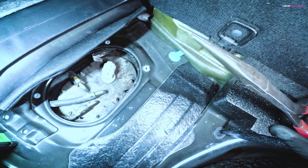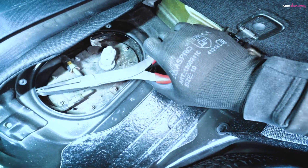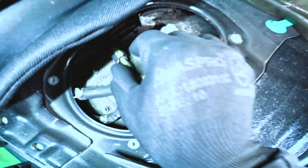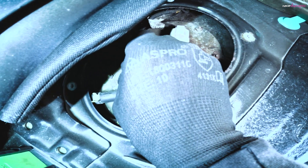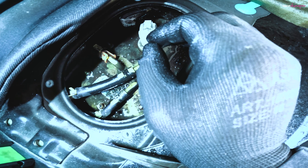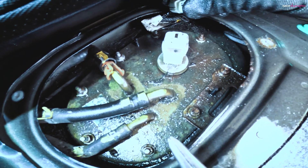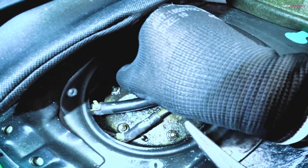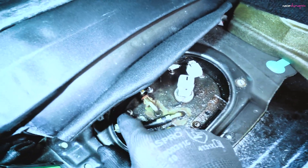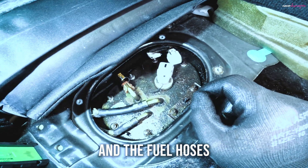Once the pressure's out of the system, using a pair of long nose pliers, just move these clips out of the way. If you see the tabs on that, push those in and the fuel supply pipe should come off — it will release a bit of pressure and a bit of fuel will spray. Move the plug for the fuel pump, so that's ready to come off. Just need to undo these bolts or nuts — 8mm — and the assembly will come out.